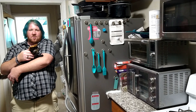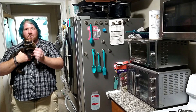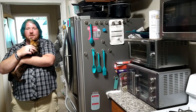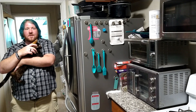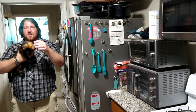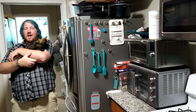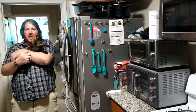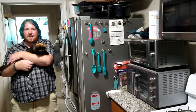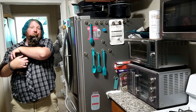The time is now about 12 o'clock, and while I was looking at my power usage, I noticed the fridge was using a whole lot more than normal and caused me to start pulling from the 12-volt battery because I exceeded the output of the DC-DC converter in the car. The reason is the fridge had gone into a defrost cycle, which is not something I need it doing during the hot part of the day when I'm also using air conditioning. So for now I've turned that off. It should keep everything cold until I end the test, but normally it would keep everything cold until nighttime. The plan would be to let the fridge run overnight and then turn it off during the day again.